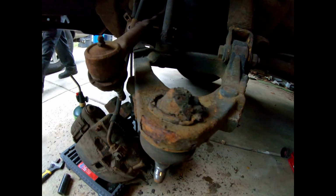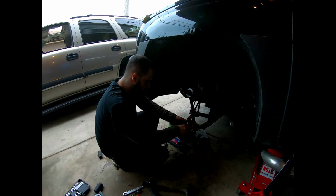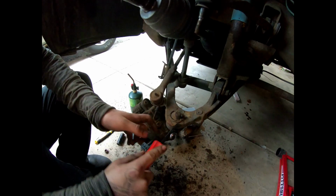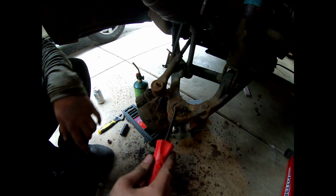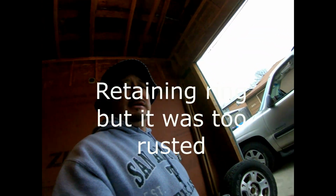And that's the ball joint that's bad right there. So this one, when you take it out, make sure you take this thing off. This is the original ones. You take this off, see the little tabs I got right here? Oh, okay. So that's just to secure it on the arm. Just lift them off a little.